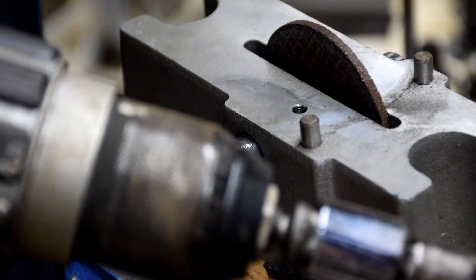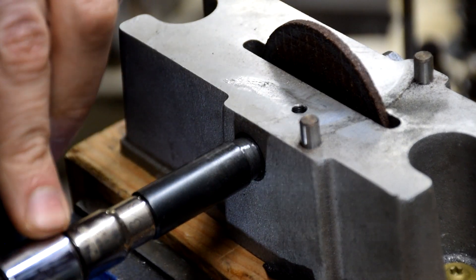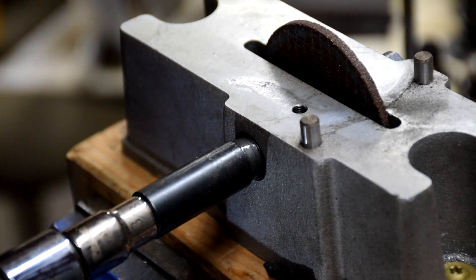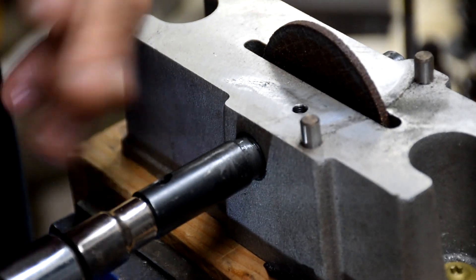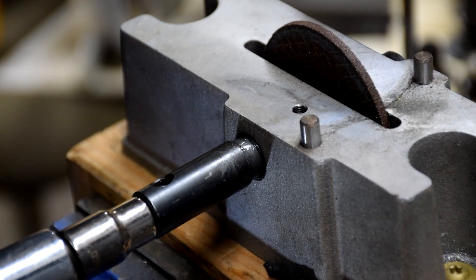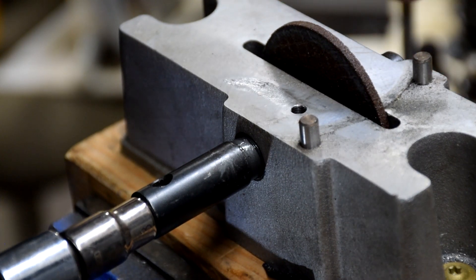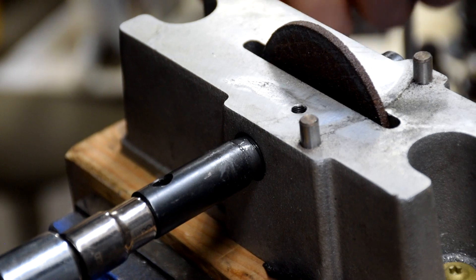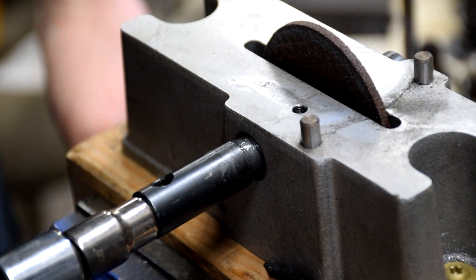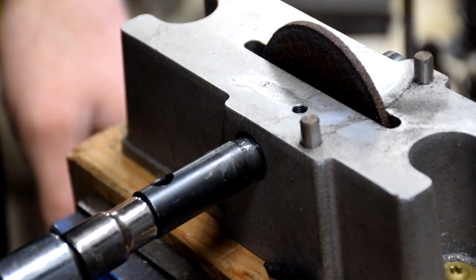What I did for a big mistake — I kind of turned the drill really fast. I wanted to be able to see the line and count the turns. If you're turning it and you can't even see that line going around, you're going too fast. That's where I had the problem and I broke off the moly coating on the top ring. It would probably be best to go slow and take your time and not have to buy a second box like I did. I bought a second box because I wasn't happy with that chipped moly coating. I got a second set just in case I go over, and if you have expensive rings you're kind of screwed.